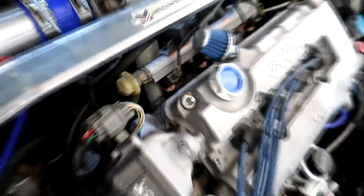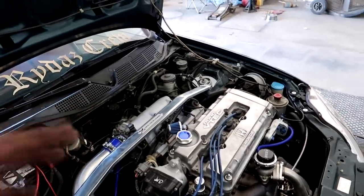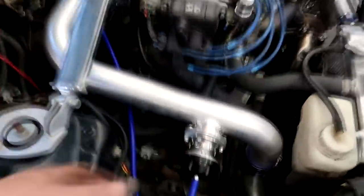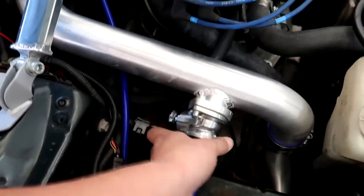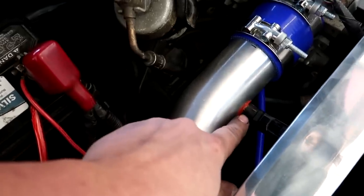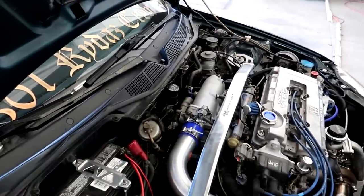I installed a set of RC550s in this car and just looking everything over — probably pull the plugs out and check what plugs and gap are in this thing. The car's put together pretty good, but there are a few concerns. The blow-off valve is loose — I don't know if it needs to be welded or not, hoping it doesn't leak. Also the intake air temp sensor is just RTV'd into the pipe. If it doesn't hold, worst case I always recommend using JB Weld — JB Weld is going to hold the boost, RTV can blow out. We'll mix up some JB Quick and fix it if needed.